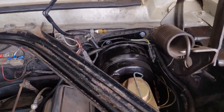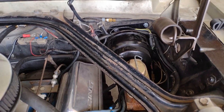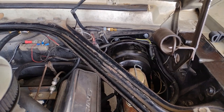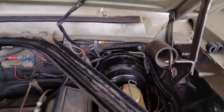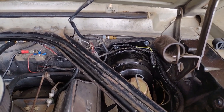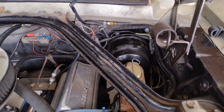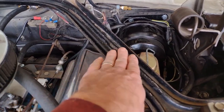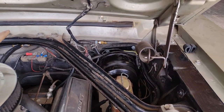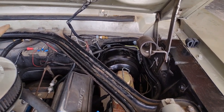You then have to mount the power brake booster to the bracket. The brake booster had studs sticking out of the back that go through four holes in the outer bracket, which you attach nuts to. When I did it, I removed the export brace but left the hood on because I was concerned about getting everything lined back up and it was just me at the time.